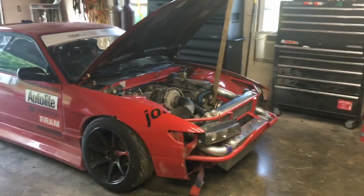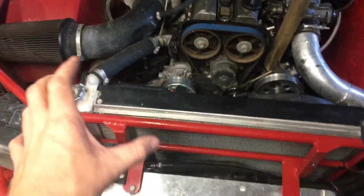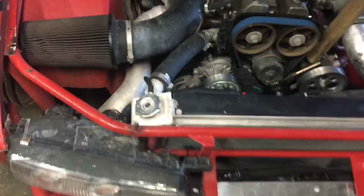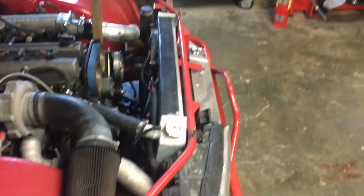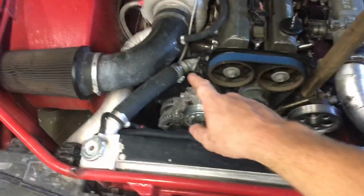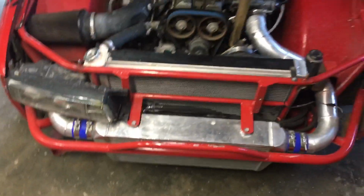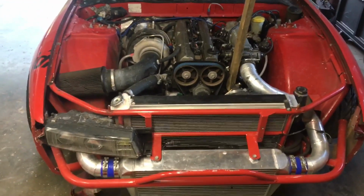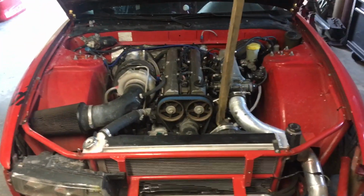I have a couple weeks left to get this thing ready to go for Gateway FD. When I was up at Auto City, you can see I was throwing a lot of coolant. I think what was happening in this radiator, which is a 2-pass custom radiator that I made, is it's cavitating up in this area. When it comes out of here, it's just cavitating and building air pressure, and not doing a full flow like it's supposed to. So what I think I'm gonna do is basically just go buy a new radiator. They're like $250, and then I'll have the outlet over here and just make it a single pass through, a single pass 4-row. It's what I ran in FD in 2016. I think if I just run it like I did, I shouldn't have any problems, because I really didn't overheat back then, but I've been overheating the last couple of times at the track. Well, at Grid Life I wasn't doing too bad, but there were also a lot of cool down laps, and I was able to drive around that track just straight. So anyways, that's it for right now on that.